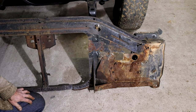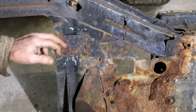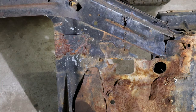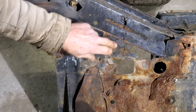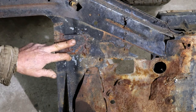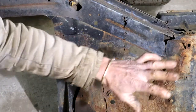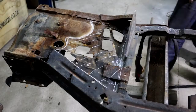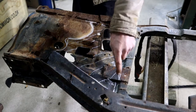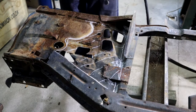Look at the state of it. You can see here some more reasons why I've called this truck 'old crackpot' - cracks here, lots of rust, patch pieces badly welded in place. I'm not interested in that. So I'm going to start by removing all the fat, as it were - I'm going to cut all this out. I'm going to use the plasma cutter on this section that I've marked out and get rid of it.